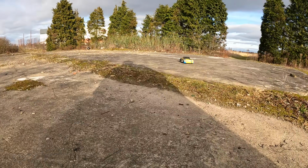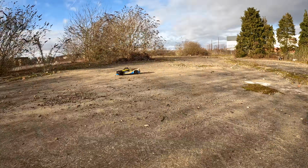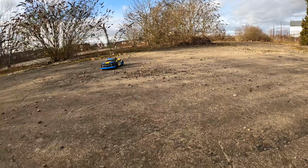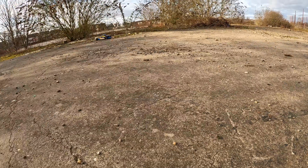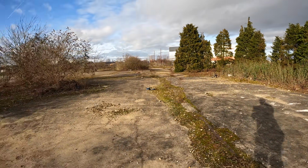The problem with having friction dampers, when you're not on a smooth surface, is, well, there's no damping, funnily enough. Literally just bouncing off the springs. That's why it's such a big thing. Even though some manufacturers might think it's only a little problem, it's actually a massive problem, and it can ruin the experience. Anyway, it's not bad.